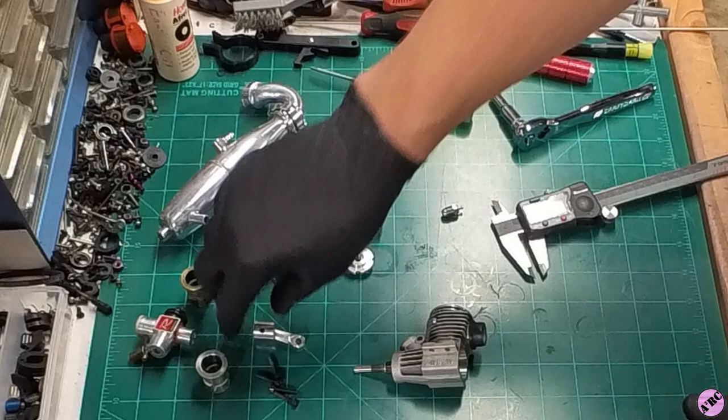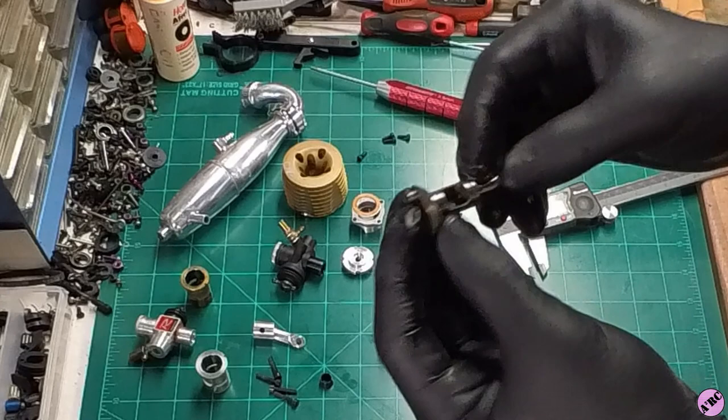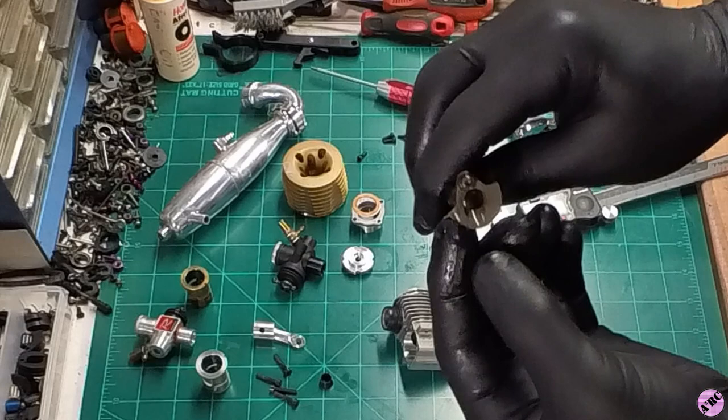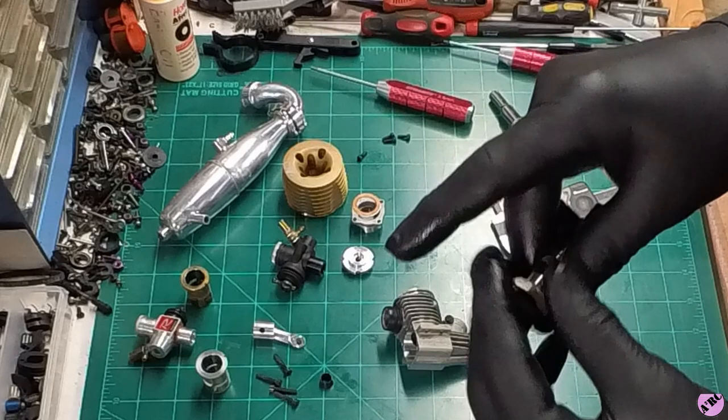Let's take off our collet and push out our crank. This is what I would call the beginnings of a standard today race crank — nice big bore window, the induction passage from the intake into the crankcase, a big bevel or big fang shark cutout on the side. This particular crank is not drilled nor filled.